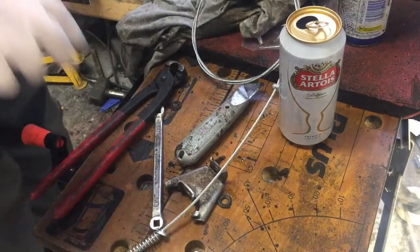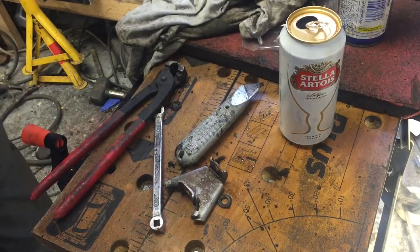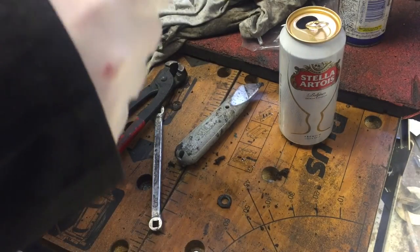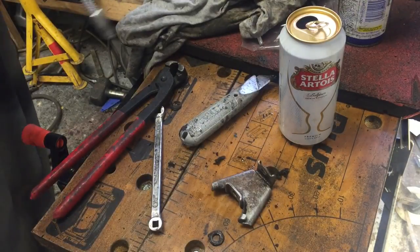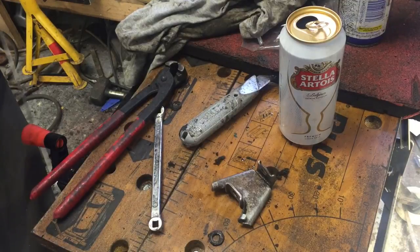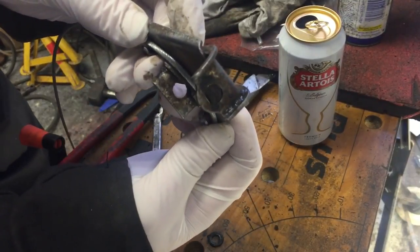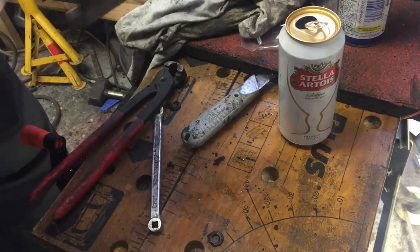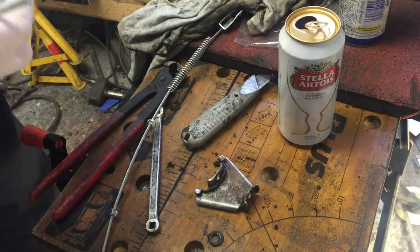Something's telling me that I also need to feed in the main handbrake cable that goes through the subframe first, because the front cable goes through the subframe and then the rear part goes underneath it. I'm pretty sure it's a bit trickier — yeah, that goes in like so and then the other cable goes through that hole. As you can see, that bit of cable is fine to get underneath it, but imagine if I had that cable in now and had to feed this all under it. So let's just do it now because it's got to be done at the same time.